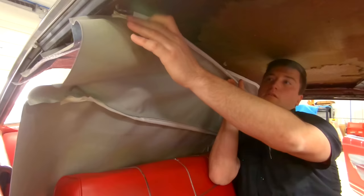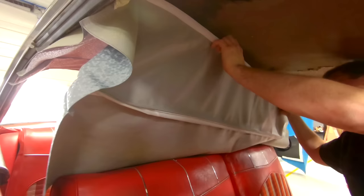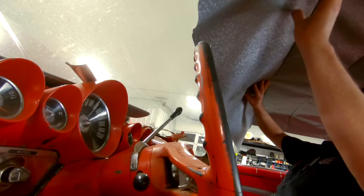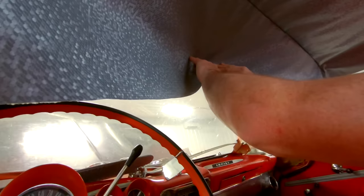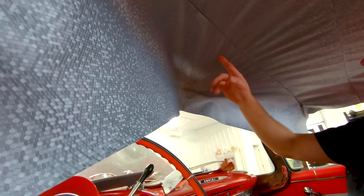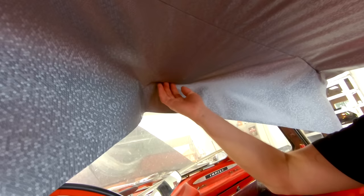On to our last couple of bows — same deal, find our mark that we made, get it to sit in that channel, and you're just popping each bow into the hole that we marked. This is why we glue it — so we can see our center mark lines up with the mirror screw, which is the center of the roof of the car. Then we give it one good pull, pulling it pretty tight. All headliners are going to have a little wrinkle, so we solve that by pulling it out left and right — if you tug on it, it pulls and relaxes. So we'll get it kind of tacked down in the center up front first.